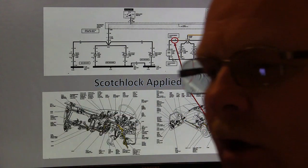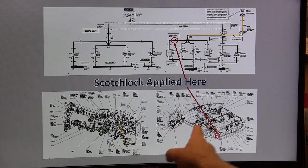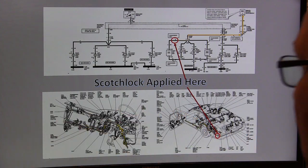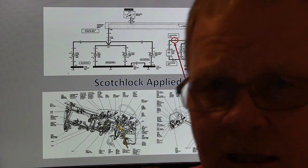He had driven all night long with those lights on and those extra trailer lights pulling from that little 22-gauge brown wire. It was a nasty mess. The scotch lock melted that wire harness — started melting back toward the power source like a slow-burning fuse. It went all the way back up under the dash, and that harness on the '95 Thunderbird also goes out through the door. I had to gut the whole car and change the entire harness. This was a three-thousand-dollar repair because he did his little scotch lock the old-fashioned way.